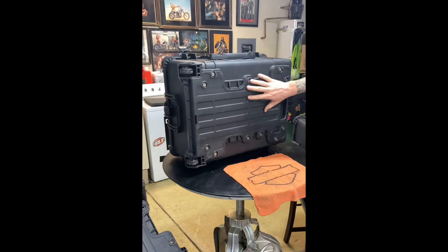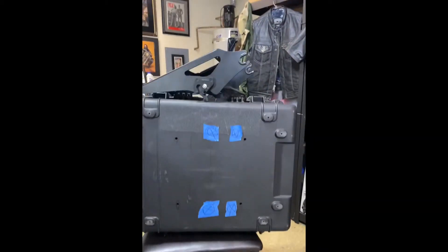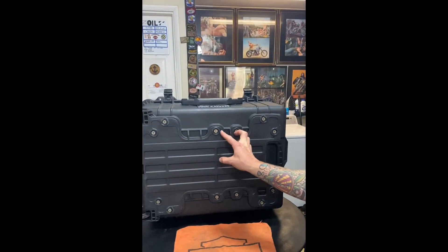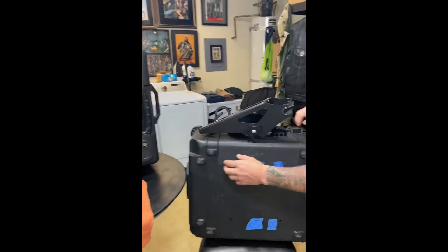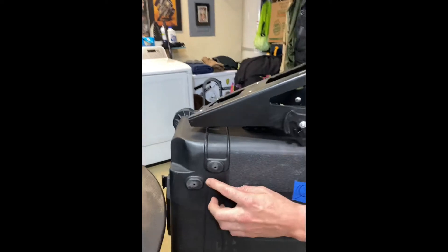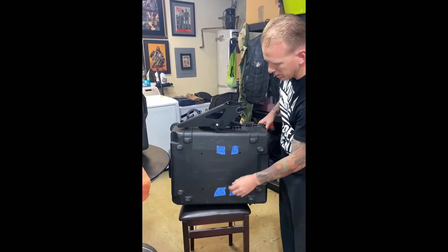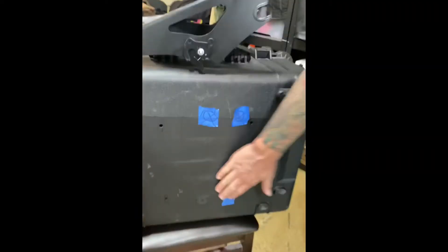So when this comes off, it's going to look like this. But the first thing we got to talk about are these two bolts right here and these two bolts here. So these four bolts have these little mound nodules right here — you're gonna have to cut them off. You can do this with a dremel; it's the cleanest and fastest, it'll melt through the plastic. But once you remove those, they should turn flat like that — just make it flush.